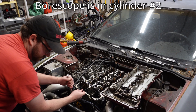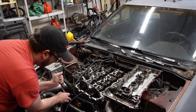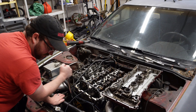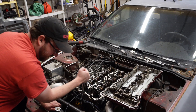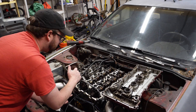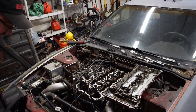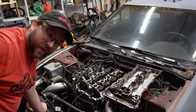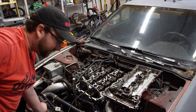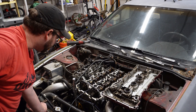Spinning the engine back the other way — that's not even moving. Do I have a broken rod? That piston isn't moving at all. Let me look at cylinder three because cylinder two isn't moving. I know what the problem is: I either have a broken piston or broken rod on cylinder two, and it's stuck near the top.